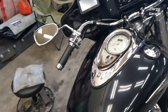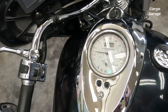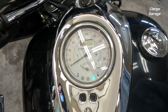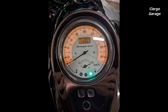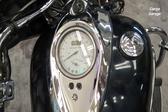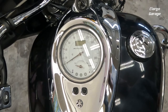That's the shirt I had down protecting the battery terminals from the tank shorting out on it. We've got the tank all secured on and the gauge cluster on, so now we'll turn the key on. The fuel light is not flashing anymore, and the gas gauge has moved up just a hair. When we shut the key off you'll see it drops and settles just a bit — our gauge should be in working order again. I'm on fumes right now so when I gas it up the gauge should rise up. It's a pretty straightforward easy job — just two bolts and one wire plug-in once you have the tank off.